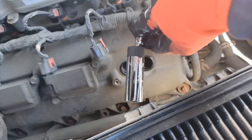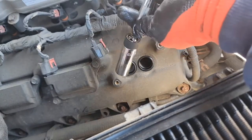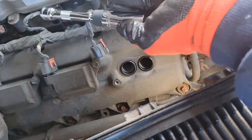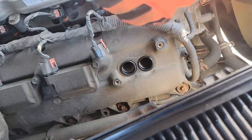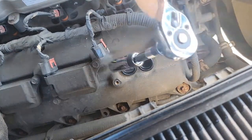Then you take your VIP of this whole deal, which is a swivel spark plug socket extension. You can see this really is going to make it a whole lot easier because it gives you just a little bit of curve that you need in order to get this done. I'll link that in the description - this particular one's Gear Wrench but just about any of them work.